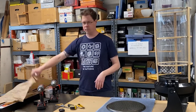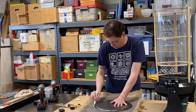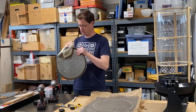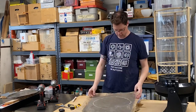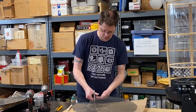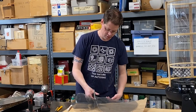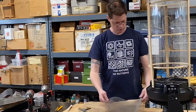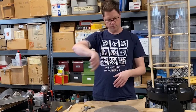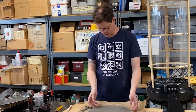I'm going to use that as my template. This packing paper from when the fan was shipped — I'm going to put that underneath and trace around it with a white grease pencil. There's the circle on the screen. I'm going to go ahead and just use scissors. The fiberglass window screen is good for this because it's softer, more flexible, and pliable. If you use aluminum window screen, there might be sharp, pointy wires. I have to kind of dart it — cut little slots around the edge so there are almost tabs that can fold up — then put some tape to secure it in place. That should give us a pretty safe wind tube.